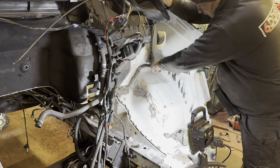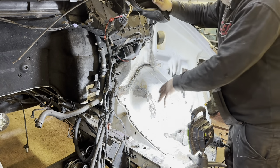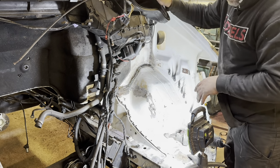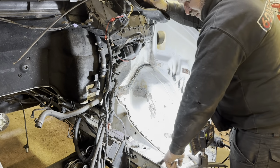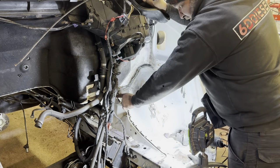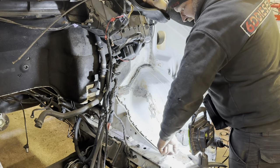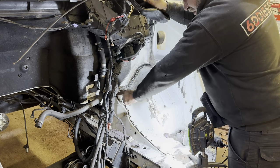So obviously we are seam welded in here. Well, it's a bit of a tidy up, but no one's ever going to see any of this, admittedly, because there's a battery tray across the top of it, but it'll just offend me. We did quickly weld it down here in the bottom, just there, obviously to hold it in place. Now I've got to pull this down onto its spots in here. Spot weld this, knock this bracket down over the top, make sure all that.